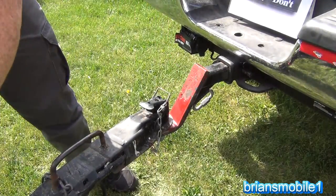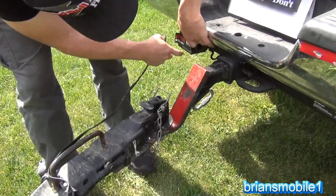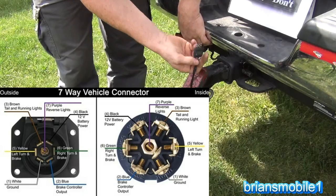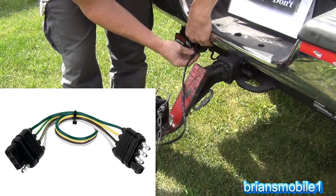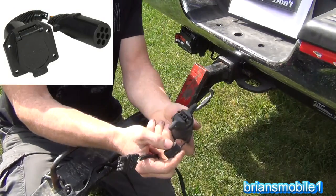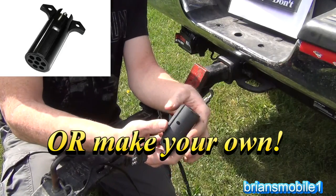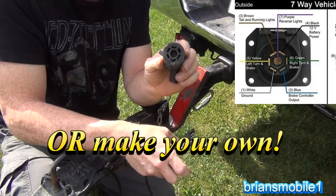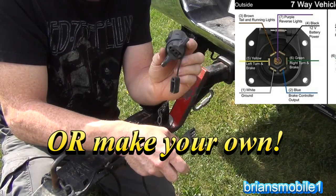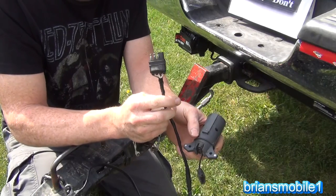The next thing you want to do is plug in the trailer wiring. This truck is equipped with seven-wire round and this trailer is equipped with four-wire flat, so that's not going to work. Don't just skip the lights — for $10 you can get just about any kind of adapter. The two most common formats are seven-wire round and four-wire flat. If you have a lightweight trailer without trailer brakes it's probably going to be four-wire flat.